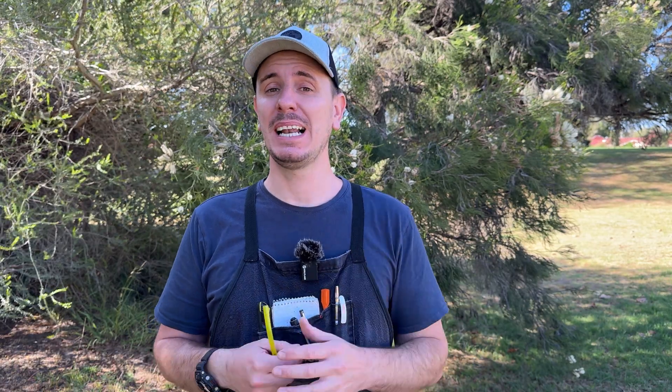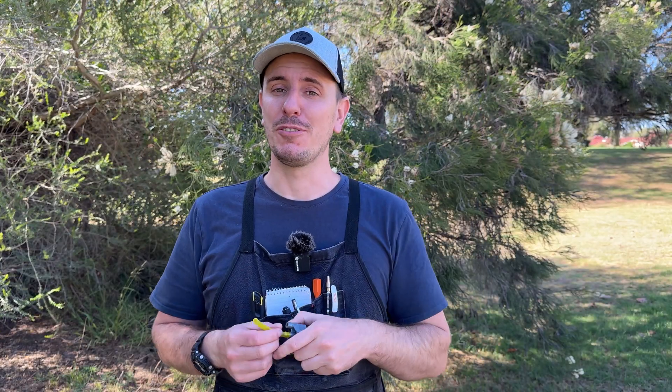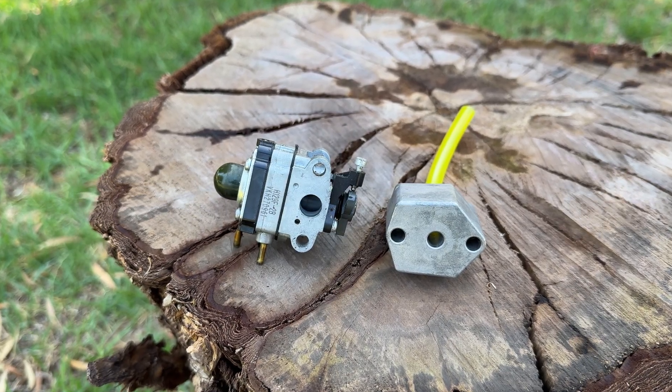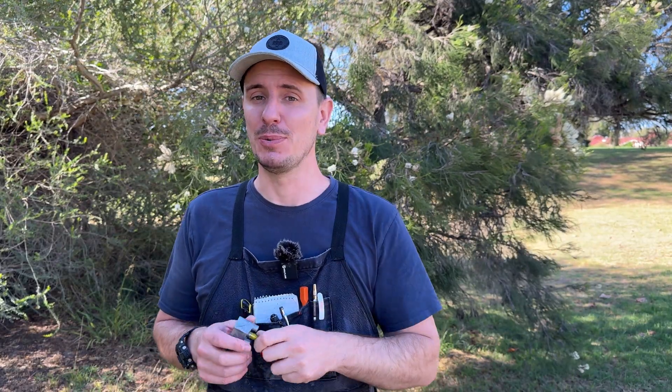However, this is a really bad idea because what that rubber can do is actually take up any clearance from, for example, a warped intake manifold or maybe compressed rubber intakes that would otherwise leak if the rubber wasn't there. That's why this small block-off plate from Stihl is so important — it replicates the hard flat surface of the carburetor, which normally seals against a small gasket, ensuring that if a leak occurs with the carburetor in place it will show itself when used with the block-off plate.